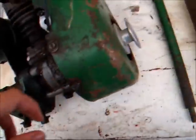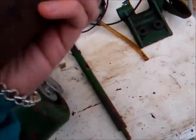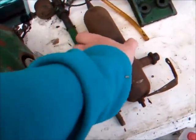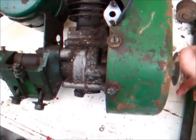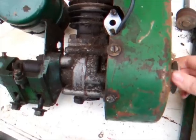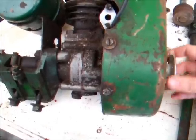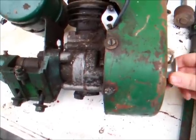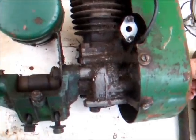Really nice little fuel tank on there. And obviously that's where our crankshaft extension comes in at the back - it's just literally clamped down. The exhaust is in really good shape. Seems to have a little bit of compression, which doesn't sound too bad when she's turning over. There is probably a little tiny bit of play in there, but I reckon once we've had the head off and actually cleaned it all out inside, we should be good. She doesn't sound too bad really.